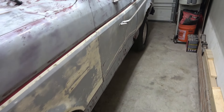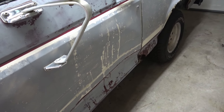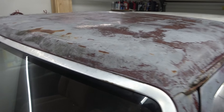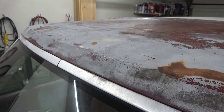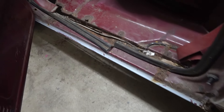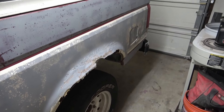Some parts aren't too bad looking, then we have other parts here - the typical spots you're going to find rust. The door is crushed, the roof actually has some damage done to it. There's bondo and possibly even fiberglass in there from people trying to repair it over the years. Down here the rockers are shot - they're just gone.